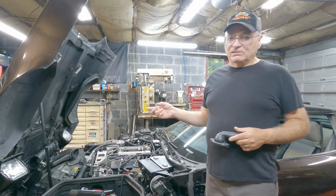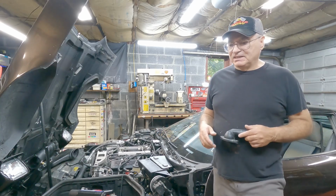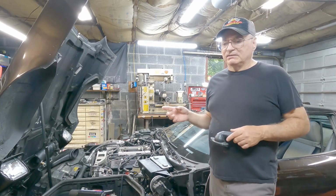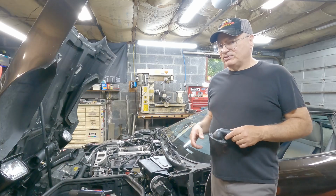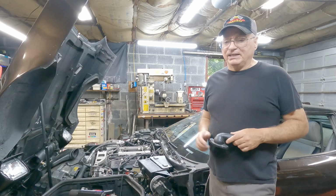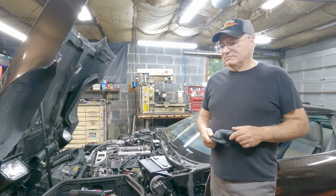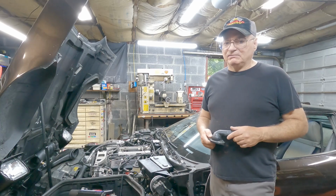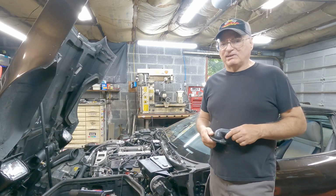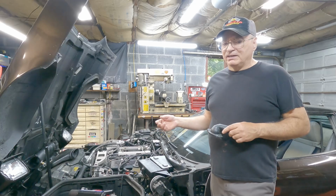The gaskets that I use, because these are aftermarket runners, you have to use these aftermarket gaskets for those aftermarket runners, because they're a bigger size than factory. No one makes them anymore, apparently. You go on the Summit website, they're unavailable. I could probably hunt down a pair, see if someone has an old set in stock, but I never liked the Mr. Gasket gaskets for the tune port.